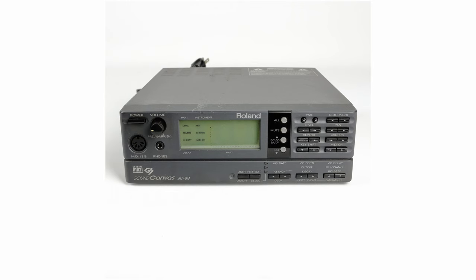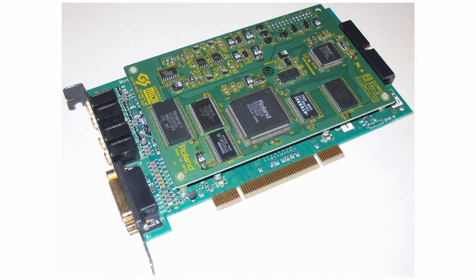As I mentioned before, you need MegaM to make external sound modules work. However, no matter what I tried, it just didn't work. I'd recommend forgetting about that, and if you really need an external MIDI device or some daughterboard, get another card that's easier and more reliable to set up, like some cheap ESS card.